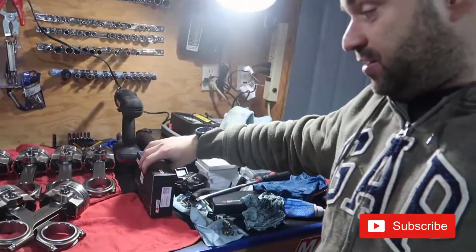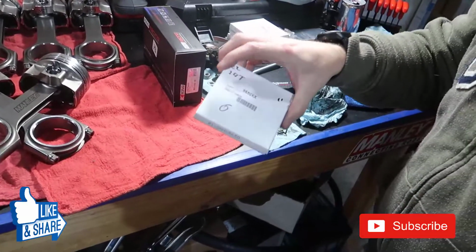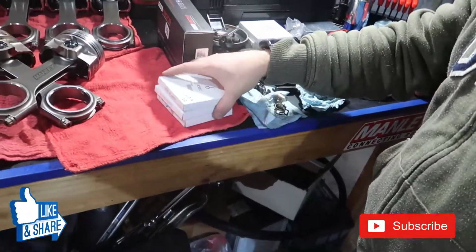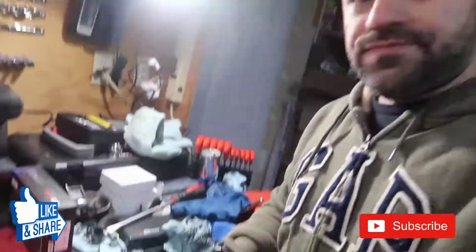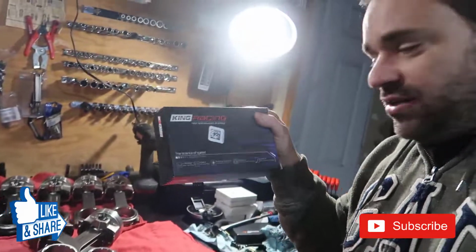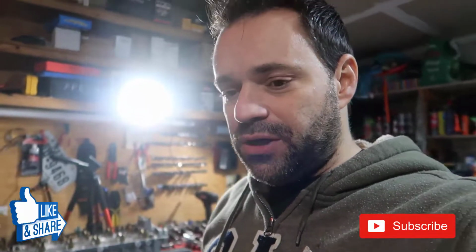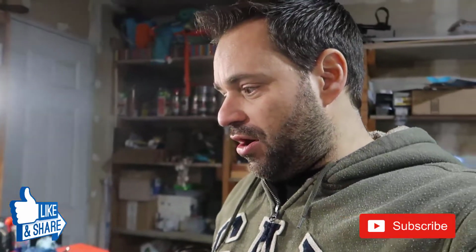We are going to install the rings on the next video, which are here, and by experience, oh, the rings are here, that's the bearings. The rings are here, which are all measured and they all have their cylinder number, so 6, 5, 4. So now I'm gonna get each one of those with the number, and I'm gonna install the rings in there. Then we're gonna drop in the engine and use the bearings, which are those here. And by experience, we need to clean them before, because they are full of crap. There's a bunch of machining metal material in there, so be aware of that.